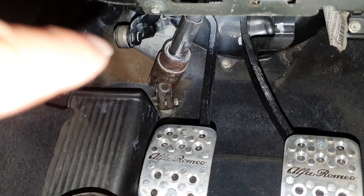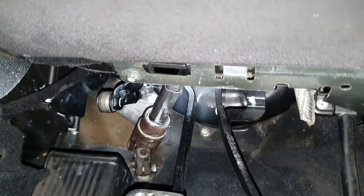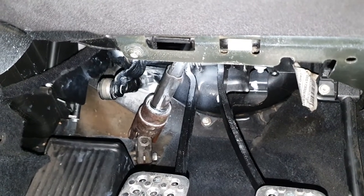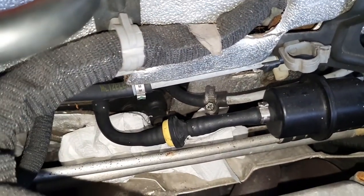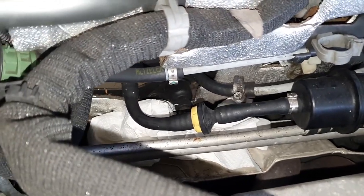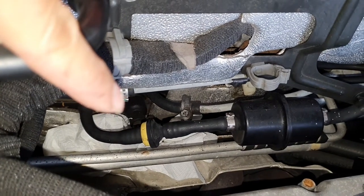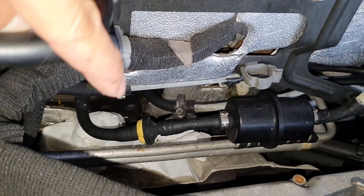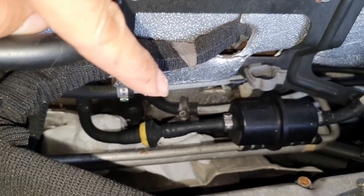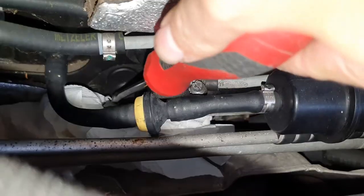You can see the master cylinder right there, connected to the clutch pedal — it's just two bolts on the inside. Once we disconnect the hoses you literally undo two bolts and it comes out. We've put some paper towels down to catch fluid, and we need to disconnect two hoses: one with a metal clip and one soft hose. Someone has already replaced my hose clip with a jubilee clip, so just be aware you might have a single-use clip.